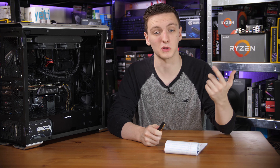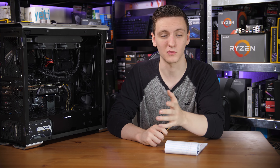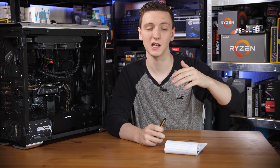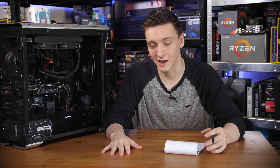My overall recommendation is B450 is great — it has a pretty decent feature set for everyone, including multiple M.2s, good overall PCIe configurations, and decent rear I/O. Every manufacturer seems to be doing an ITX board, or at very least a wide range of sizes from ITX to mATX to full ATX, so this is becoming a platform where you can buy basically any board for any chassis size and get a pretty decent experience with some impressive chips.